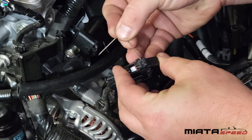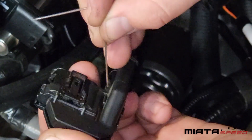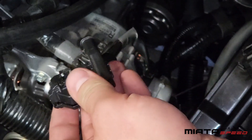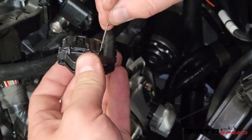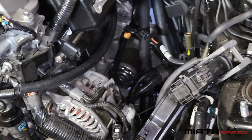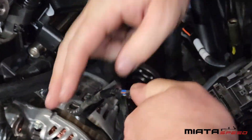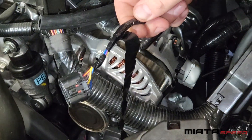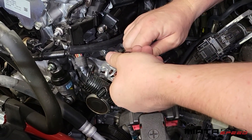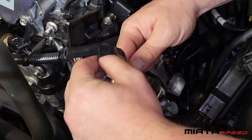You do that by unclipping all of the little clips around the edge — there's one here, one here, one here, and two on the inside. Once you get those off, this harness will be long enough to plug right in. You can do it using a small flat-head screwdriver, or like I like to do, a couple of T-pins. Now you can see I've got a couple extra inches out of the harness. Wrapping it up with some electrical tape is a good idea — I like to use the remainder of what's wrapped around that 180-degree adapter when you first start taking it off.